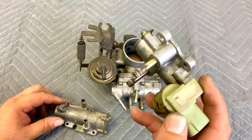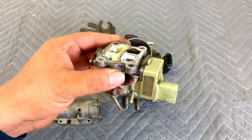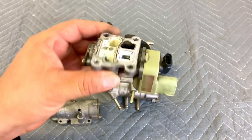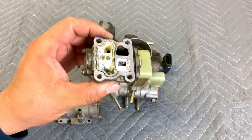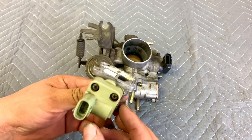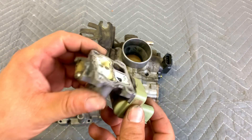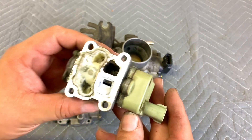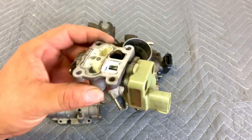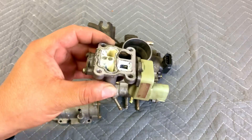So this is half electronic and half mechanical, while the older one is 100% mechanical. If this valve is not functioning right you might have poor RPMs or high RPMs because too much or too little air is getting into the engine and it's not being controlled properly. You can do simple maintenance to this valve to get your RPMs back to normal. These are very expensive components — you might spend a couple hundred dollars just on a new valve when simple maintenance can save you that money.